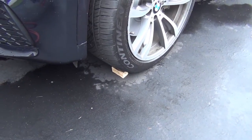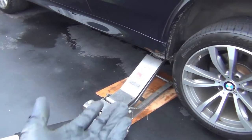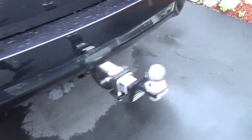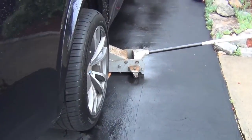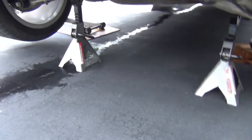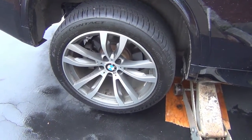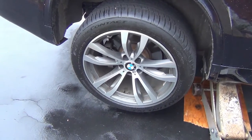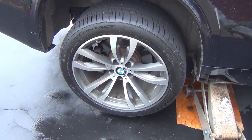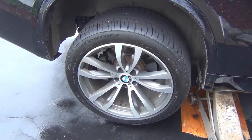Make sure to chock the wheels. BMW does have certain specific lift locations, so you can find the pad under there and just set up. I like to use a piece of wood to protect the driveway. I do have both sides set up to make it easier, and always make sure that you use stands for safety. I'm going to show you how to do the right side — the left side is the same procedure, except that you don't have to install a new replacement sensor. The sensors are only located in the left front and the right rear on BMWs.